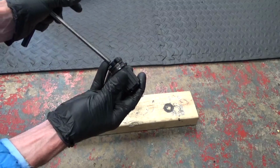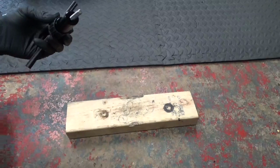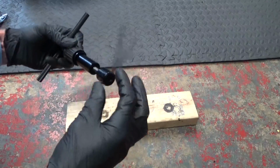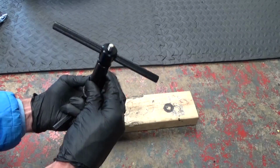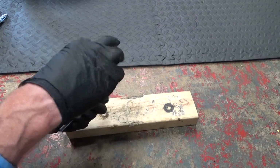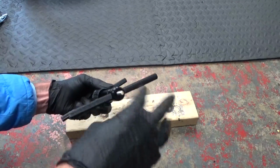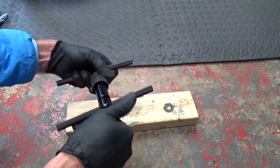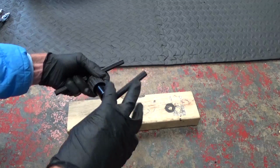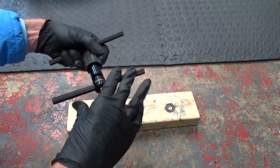Right, so what we do now is just set up the press that bearing all the way down into the bottom. So just push that through the first seat at the top, and then it will drop inside the Freehub. So just keep winding it on down, then it go loose slightly, and you keep pressing it down. All the way until it hits the bottom like that, till it stops.